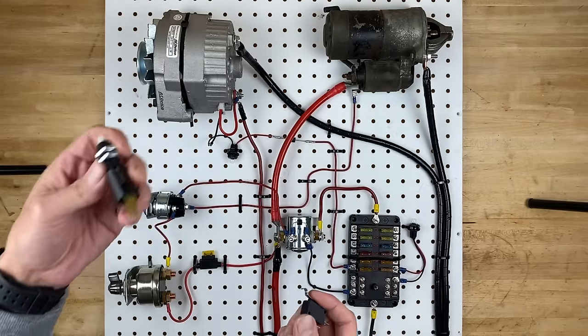We now have the solenoid in place and it's actually pretty easy to set up. Main battery power comes in and jumps right from this solenoid terminal to this solenoid terminal. On the output side you have the big battery terminal going over to the starter. The ground wires go to the fuse box here because there's a good ground, but you can actually ground those right to the chassis. The only other difference is the wire coming off the neutral safety switch — instead of going all the way to the starter, it now activates the solenoid. And as I showed earlier, we jumped the big power terminal right to the starter solenoid activation terminal. Now with the master on and the key on, we get nothing without the neutral safety switch, but with it we have a good running starter.